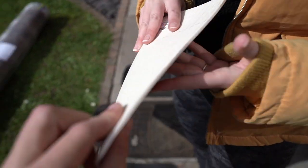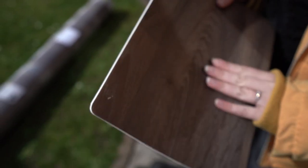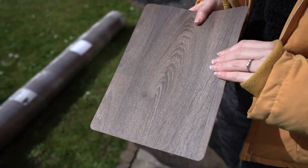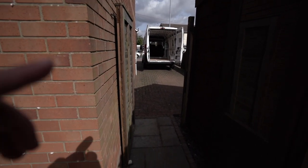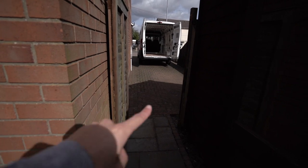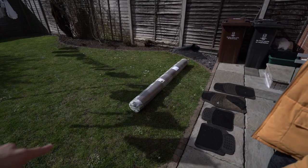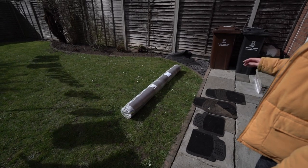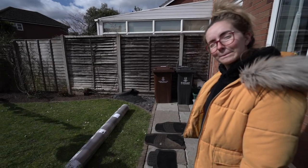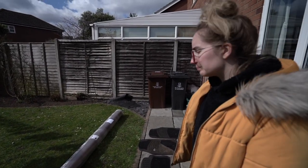It's nice and soft — pretty good and squishy. The plan: we need to take all the flooring out, that's why we didn't screw it down. We're going to take everything out, lay it on the driveway, lay the vinyl on top, do a rough cut so we don't have to do the majority of the cutting in the van, take all the plywood back in, screw it down, put the vinyl on top again, do the final trimming and then glue it down.